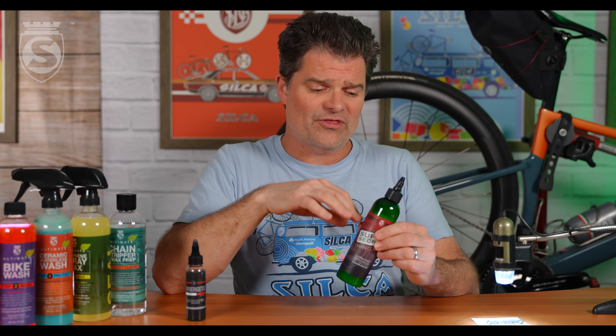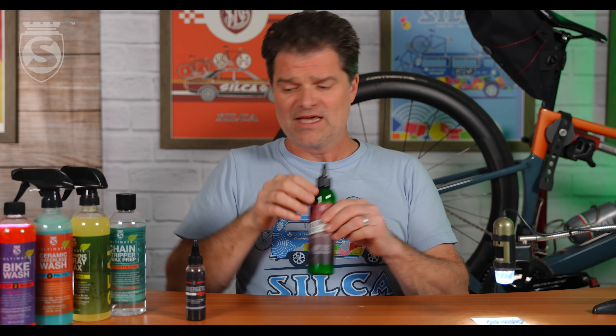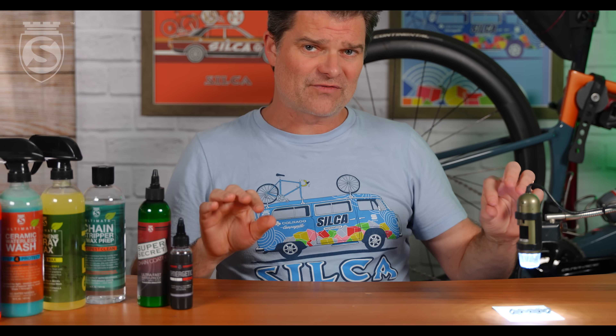One of the problems with a lubricant in a water-based carrier is that when you apply it to the bottom span of the chain, if you're using a higher-end chain that has a special coating on it, it's typically going to want to run right through. I see this in the comments a lot. People on YouTube trying to apply it say it just wants to run right through the chain onto the ground. The reason is high-end chains have a hydrophobic coating — in most cases hydrophobic but oleophilic: hates water, loves oil. So of course a water-based lubricant carrier is going to want to run right off that chain.